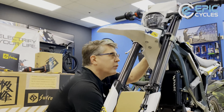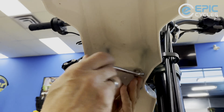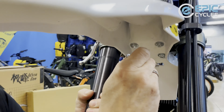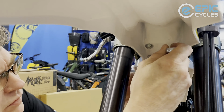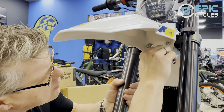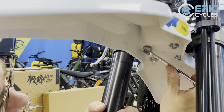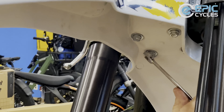This being plastic, you don't need to put a ton of torque on it. Take your wrench and just snug up the bolts — you can see by the effort that I'm putting in, I'm not putting my arm right into it. You just want to make sure it's snug enough. The bolts are pre-lubed so that in the future when you break your first fender, it will be easy to reinstall a new one. My rule is: if you don't break anything, you haven't had enough fun with your bike yet.